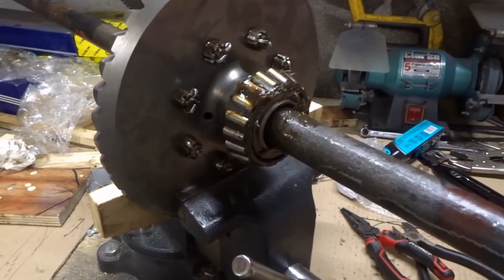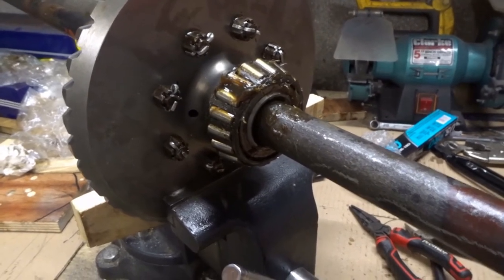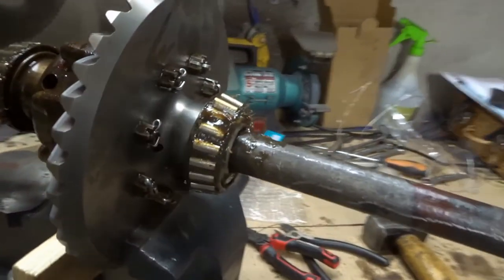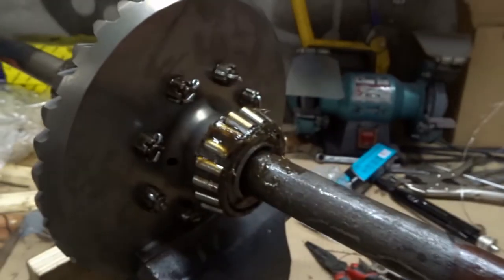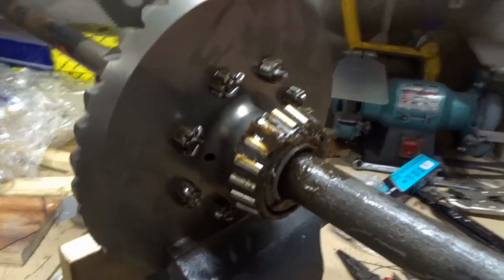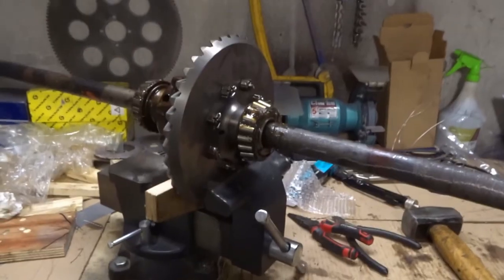I haven't used the lock wire in the end. The holes are quite big, so unless I use very thick lock wire, the nuts could actually turn quite a bit before the lock wire restricted them. It seems to me that the plan the previous builder did - which was to use split pins, cotter pins - was actually more sensible. The nut can only turn a fraction before the pin binds it and stops it undoing any further. I've done it the way the previous person did it and been very careful to make each one extremely neat. They don't rattle about and they're tapped in with a hammer so they're fairly tight.